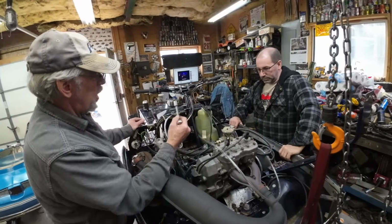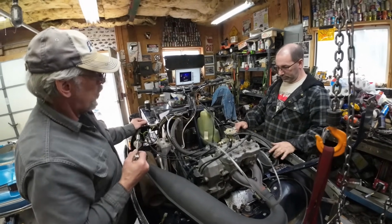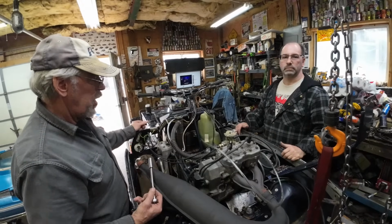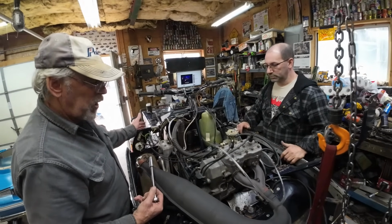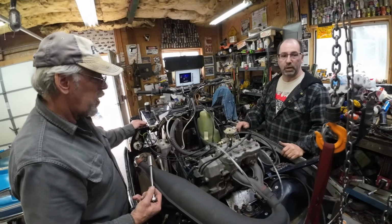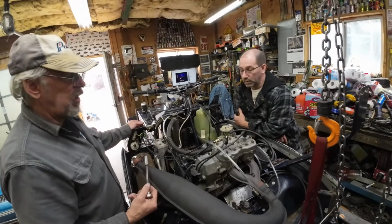Got a quart of oil in the tank. The tank's mounted on the bracket, and a little bracket we welded on there to hold the oil tank. I just got to get a couple of shorty 38 millimeter foamies. All we got to do is the final plumbing then, and it's ready to rip. Yeah, pretty close. Fuel line. Still gonna eliminate this tower. I'll make a little block off plate there like I do on most of them.